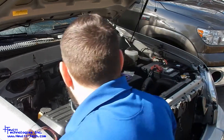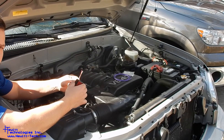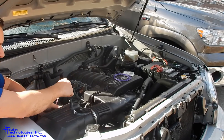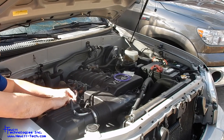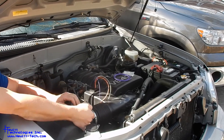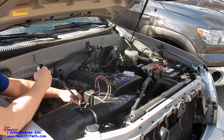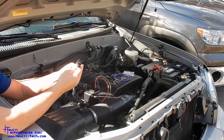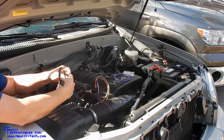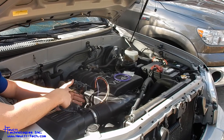To get started, keep in mind that to make these connections, we do need to mount this somewhere close by. Since we're going to do the wiring somewhere nearby, the back of the air box is handy. You'll want as much wire here as you can to work with. We're going to disconnect this sensor — just give the tab a little squeeze and pull it off. Pull this harness out. There's a little clip here you can take it out of too. Then with a finger or a small screwdriver, you're going to want to split this wire loom open and pull all the wires out. Just get it split and then you can usually just pull it apart. The more wire you have here to work with, the easier it will be.